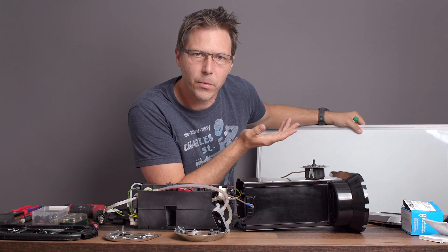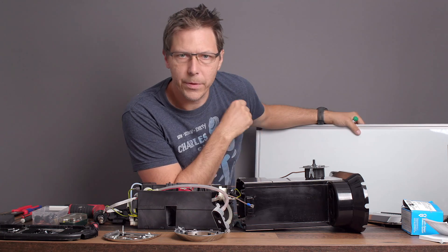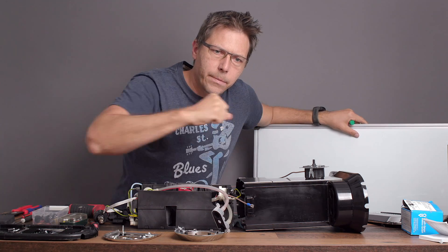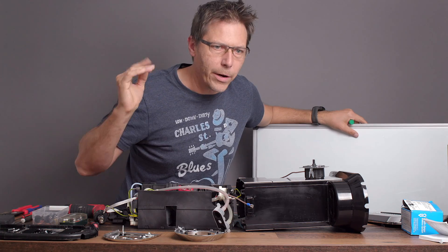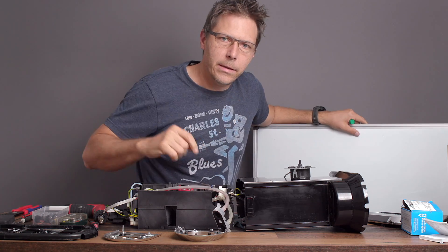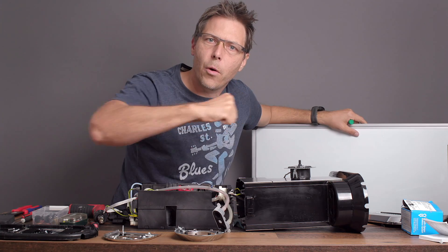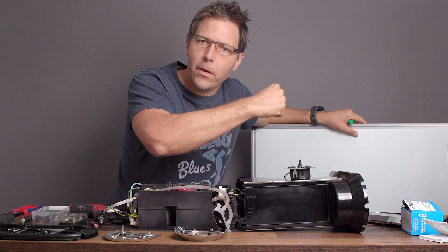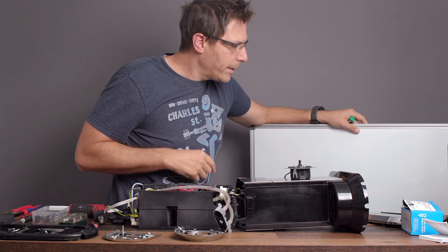It all has to do with flow control. On a normal pump machine like this one, where you can't really do too much to control the pressure, you've got a piston in the pump going back and forth over a ball and pushing the water — it's basically only limited by the overpressure valve. If we want to lower the pressure, what we can do is limit the voltage that makes it to that pump, because the voltage is basically what causes the piston to go back and forth.